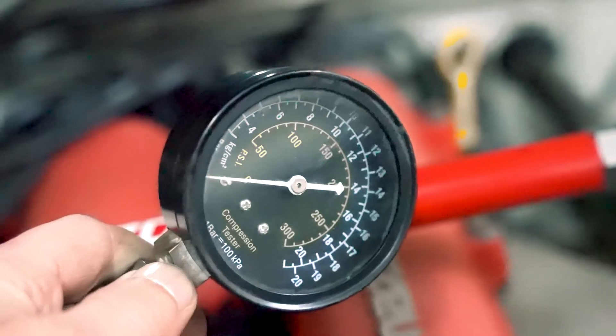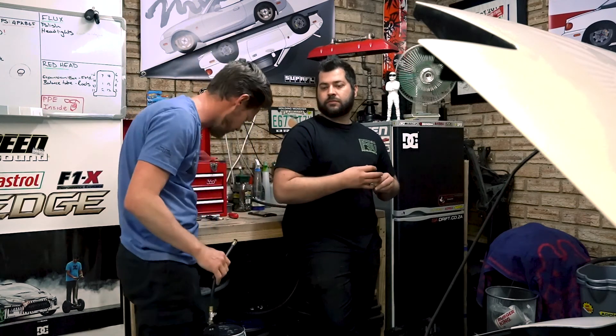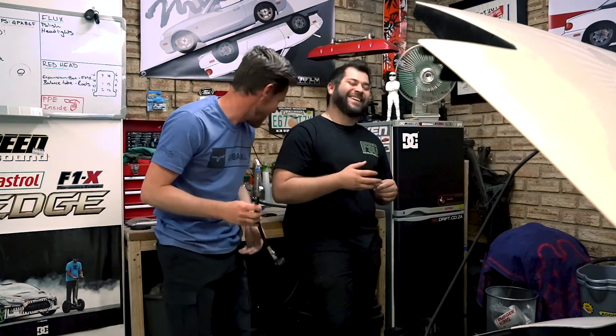Was that an exercise in futility? This motor might be shot — 110 PSI. We'll work with PSI because the bar reading on this gauge sits really tucked in by the bezel and isn't easy to read, and PSI is a little easier. So it's 110, 110, 109, 110 PSI across the board. The 109 could literally just have been a fraction of a rotation too few compared to the others.